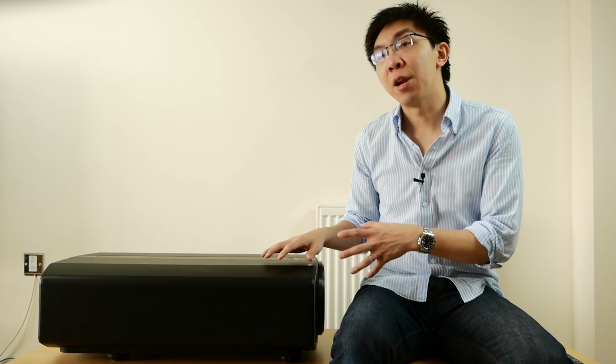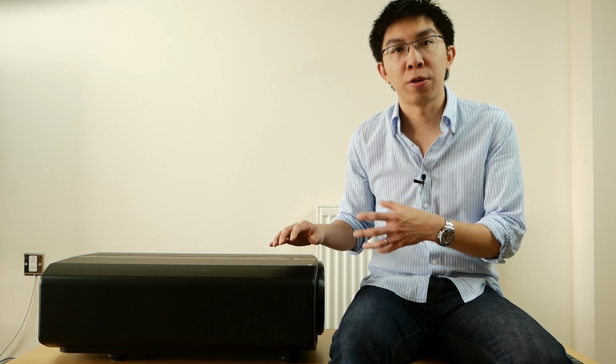Okay, with Color Profile set to HDR and the machine calibrated to ST2084 standard with an appropriate multiplier factor, the JVC Z1 delivered the most impressive 4K HDR Ultra HD Blu-ray presentation we've seen from a projector so far, thanks to increased luminance, razor-sharp optics, and improved tracking of PQ-EOTF, that stands for Perceptual Quantization Electro-Optical Transfer Function, which is the video signaling standard used in HDR10.